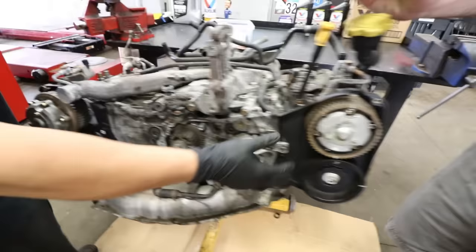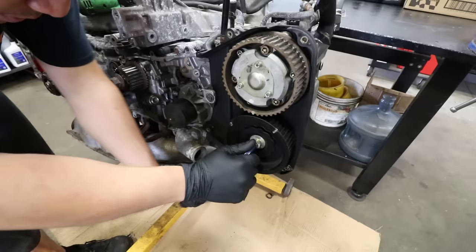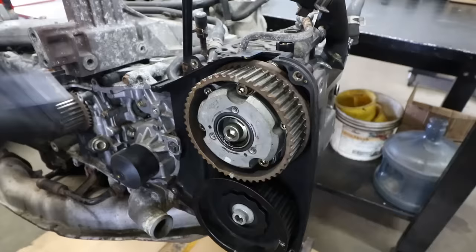But on the left side the cam is loaded. So what we're going to do is on the bottom, slowly, with a 10 millimeter Allen key, just release the load off the cam — and now it moves smoothly and freely. On this side, we need to remove the eight millimeter caps and, with your fingers out of the way, take these off-load.